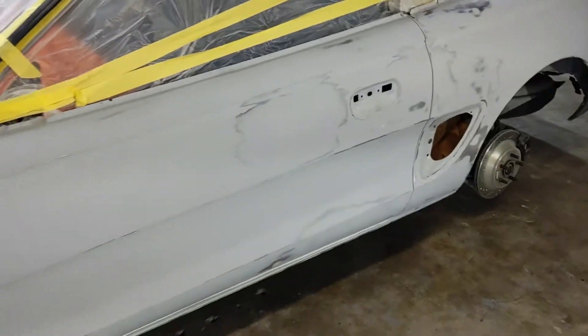The main issue I had initially was this gun. It's a great gun, but it's a suction feed and this is a lot of surface area. My little air compressor - this is fine for doing a hood or cutting in some stuff, but it just ran out of gas. It's not the gun's fault, it's my system's fault. Whenever I switched to this cheap little Campbell Hausfeld, that's where things really turned around. That's what I used to shoot the color.